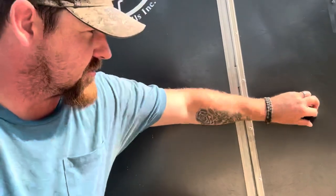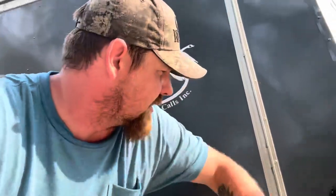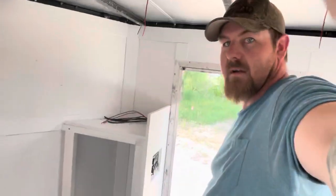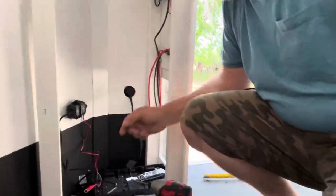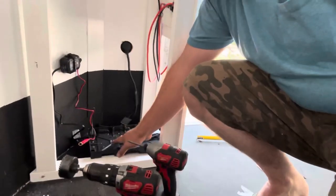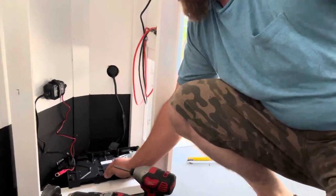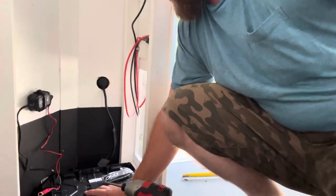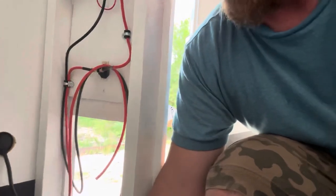Updated on where we're at — we got our NOCO external plug installed here, going right through so we can plug in the trailer at the end of the hunt and that'll run our chargers inside. We have our cabinet all installed, mostly anyway. Here's our power running in from the NOCO plug, our little two-amp onboard charger, and our battery tray — which I need to put some more two-by-fours underneath to secure it down because I didn't measure the Group 27 battery tray first. We also got all our eight-gauge primary wire run. I didn't put the ends on yet because I don't know how long I'll leave the leads.